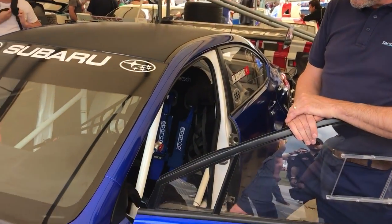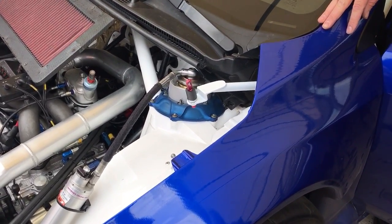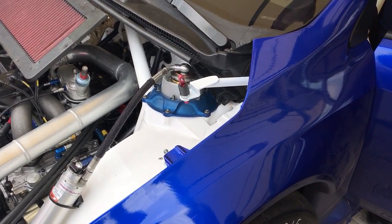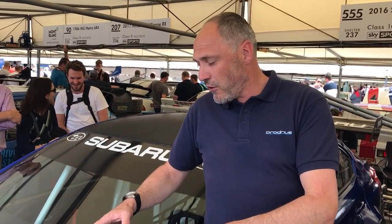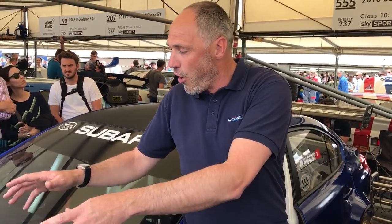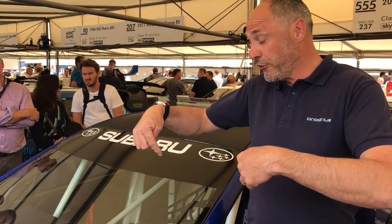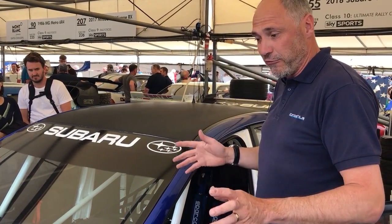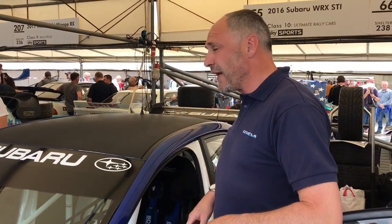The damper is made by a company called XTC in the UK - they've been our technical partner for a very long period of time. It's four-way adjustable, pretty straightforward in normal architecture, but one really nice element: a standard McPherson type strut has a DU bush arrangement, whereas we've got a five-bearing roller. We're doing a rain dance this weekend, and in low-grip humid damp conditions that's where we really start to be quite good, because we can manage our contact very well with our low-friction dampers. All bearings and all suspension on the car have roller bearings and thrust rollers - so any longitudinal loads fed into the suspension don't turn into friction, and friction is your enemy when you're wanting to maximise grip.